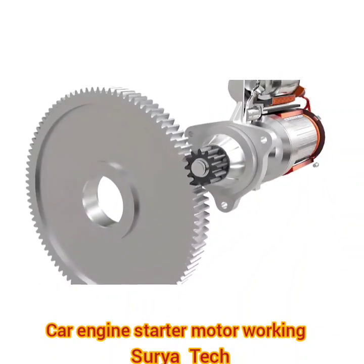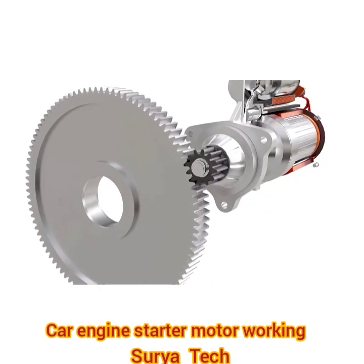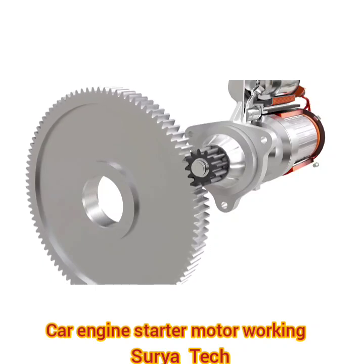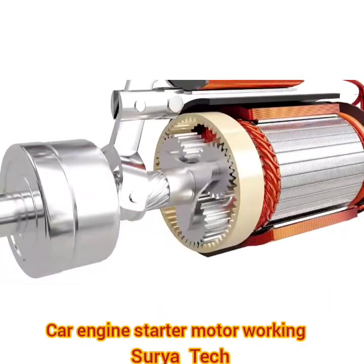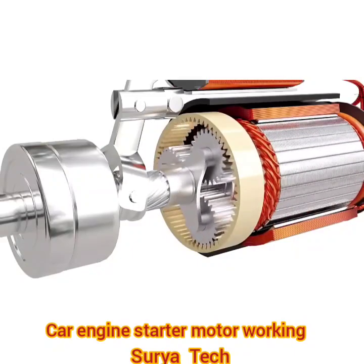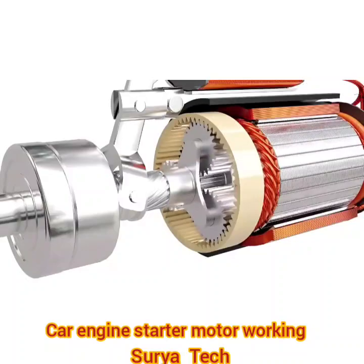As we can observe, the pinion is considerably small compared to the flywheel. The gear ratio of the flywheel and pinion is generally from 15:1 to 20:1. The high torque obtained from this gear reduction is still insufficient to crank the engine. So, a planetary gear set is introduced to increase the torque further. Planetary gears are incredibly useful for large gear reductions with less weight and limited space.